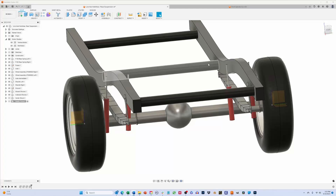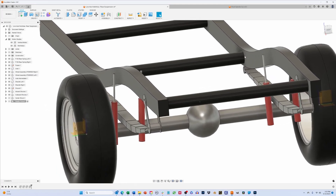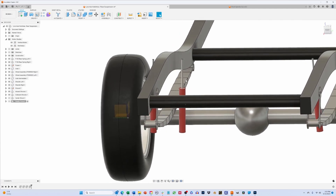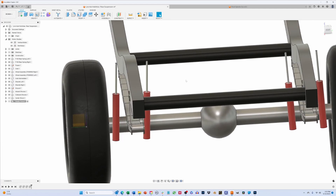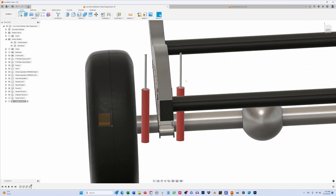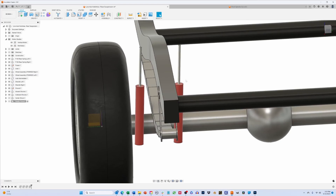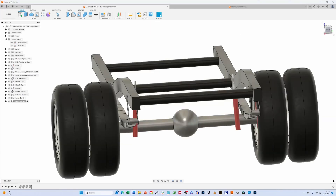The idea then is to locate the shocks as far outboard as possible, but that leads to another problem. Shocks are fairly tall devices, and there is a frame rail that sits in the same general area where we want to put our shocks. This means we are limited in possible placement — they can go outboard of the frame rail or inboard. Outboard of the frame rail is also where the tires sit, so we need to ensure there is enough space between the inside wall of the tire and the frame rail. This is not always the case, especially with dually tires on a Super Duty pickup truck. In that case, we are forced to put the shocks on the inboard side of the frame and accept less damping in roll than in vertical motions. As always, suspension design involves compromise.